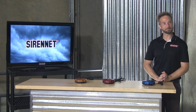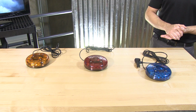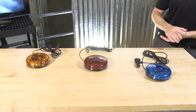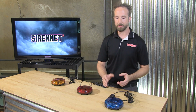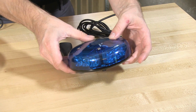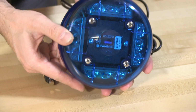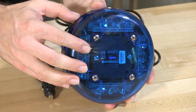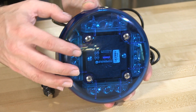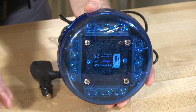Now, you've got the beacons in question. I do. They are the Tornado LEDs. They are indeed. It's a wonderful product here, again from the United Kingdom. The Tornado LED beacons are a storm of 360-degree lighting output, and it's simply done through a configuration of 4 high-output Cree diode-based modules. So, giving you a look now, you'll see that the 360-degree output within this colored, nice, durable polycarbonate non-optic lens is simply achieved. So within these 4 modules, 3 diodes in each.